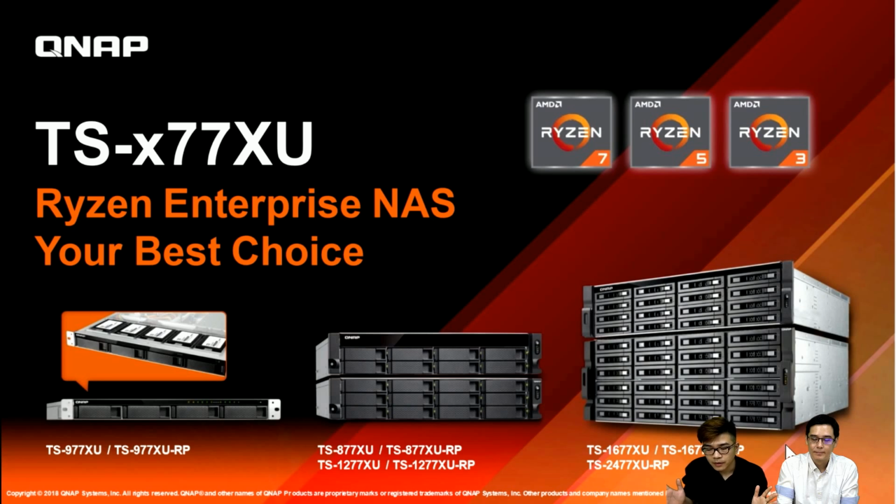That'll be everything that we want to provide you for the TS-x77XU family, with 2 to 4 GPUs that you can choose to install in your NAS. That will be a very powerful weapon for you to do the AI thing or the computing thing, the transcoding thing. And we have 2 10 gig SFP, and we have USB 3.1 in Type A and Type C, and we can support DDR4 up to 64 gigabyte. And you can choose redundant or single power. With as many options as we can provide, I think there will be one that can fit your satisfaction.